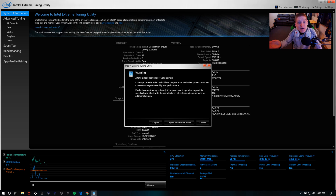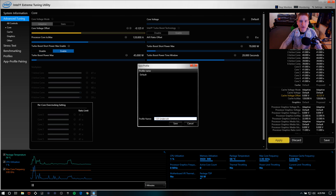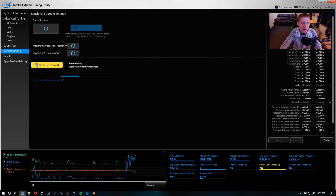It's just going to cool the CPU down. If you go too far with the undervolting then yes, you are definitely going to be losing performance, but if you only go down by around negative 130 or negative 125 — which is what I ended up doing — with my Dell G5 gaming laptop and the i7-8750H, the setting is negative 0.125, and that will make your CPU about 10 Celsius degrees lower.